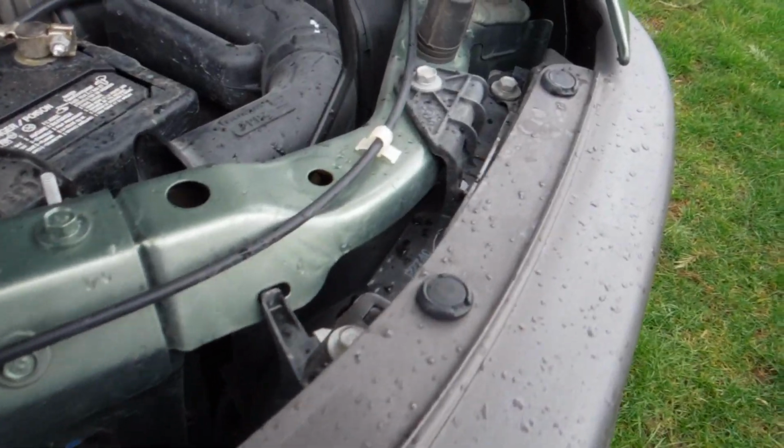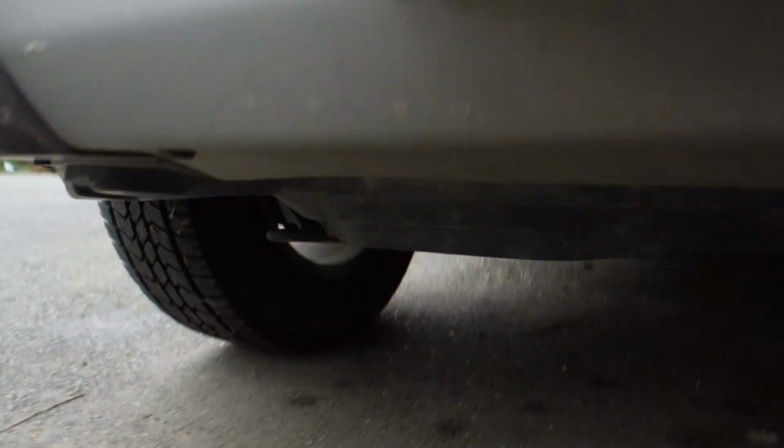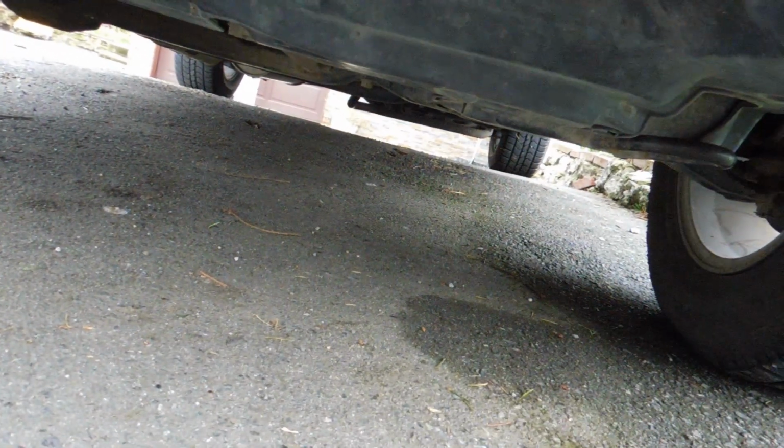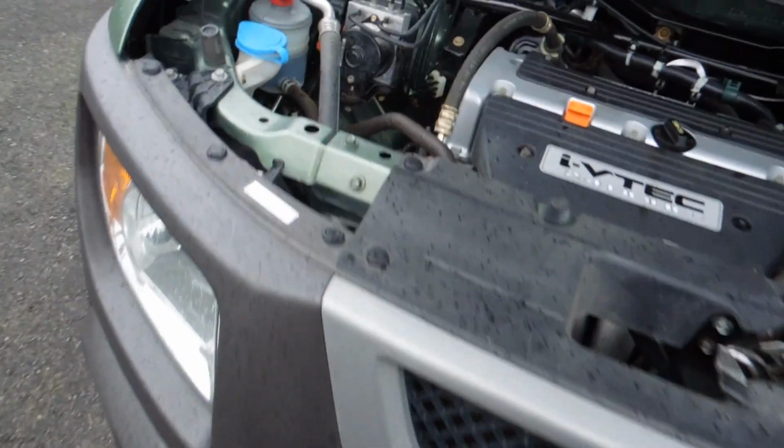And then from there we go to the wheel well. We have one in the wheel well. Then, if you look under here, you'll have four more pop rivets. You're going to pop those pop rivets. This is where you're going to use your 10mm. Pop these bolts, pop those bolts. And then the 8mm are for the side. So do that, and after that, I'll give you the next instruction.